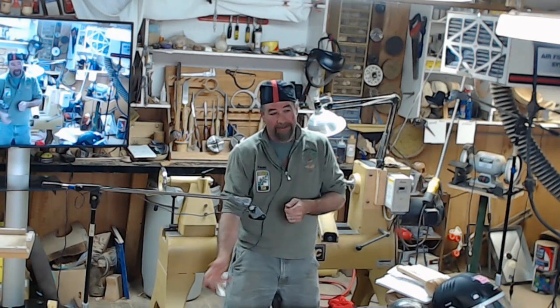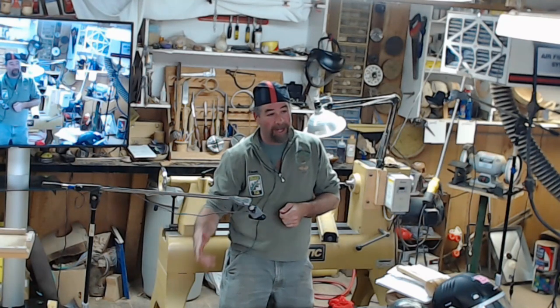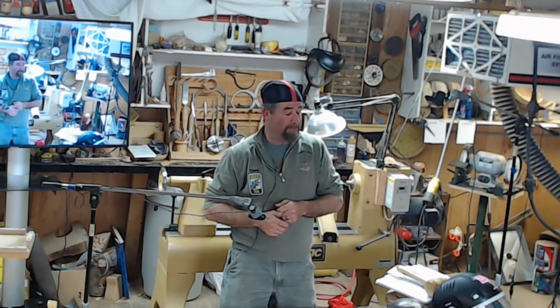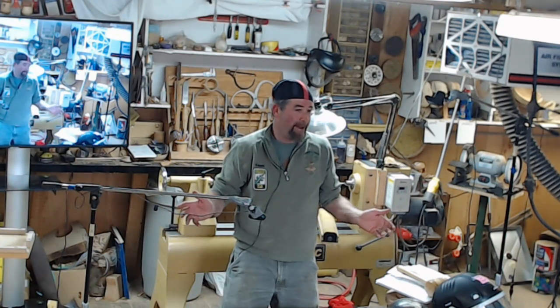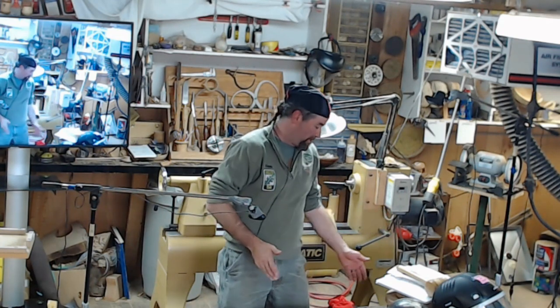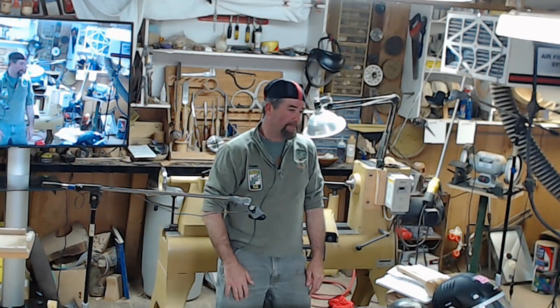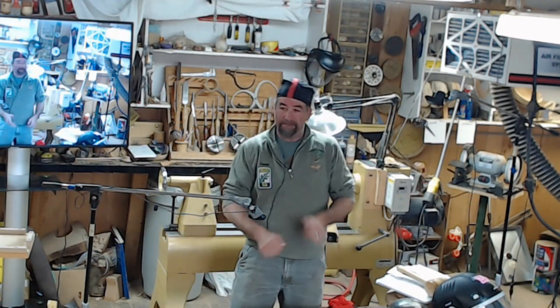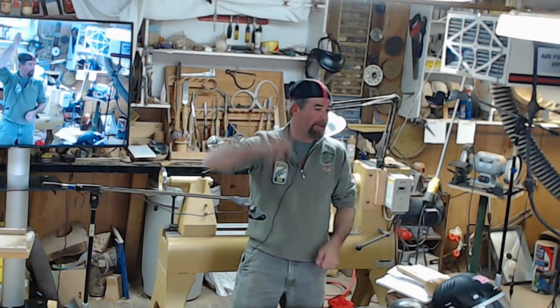A lot of guys won't even, I always started my saws on the ground, or have one of the guys on the ground say, start my saw, run it, let it warm up. That way when I get up in the tree, it's easier to start. Sometimes I'm in a bad spot and I can't start a saw, or if I'm trying to start that big one in the tree, it's tough. So I'll start them on the ground, set the chain brake, and then bring them up running.